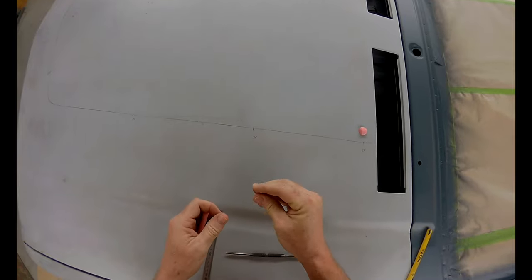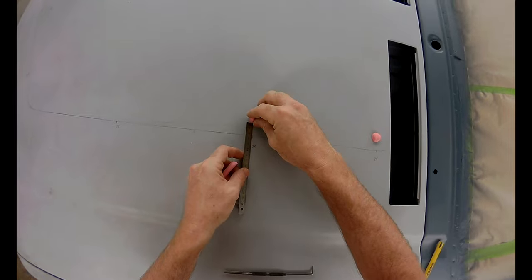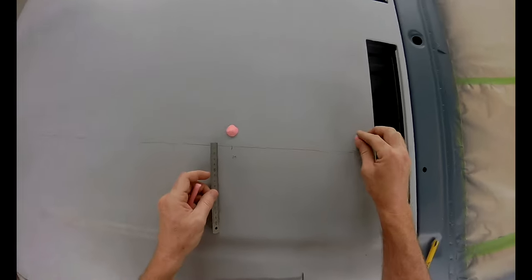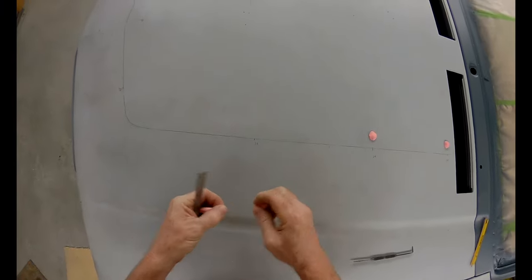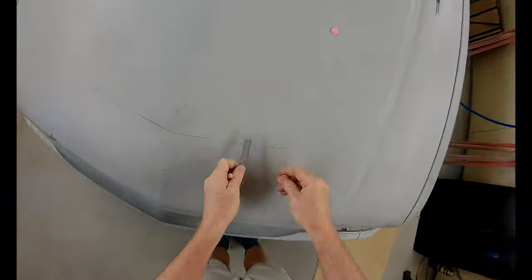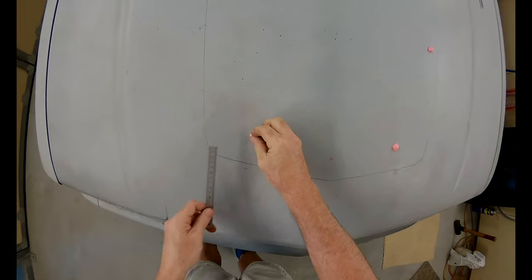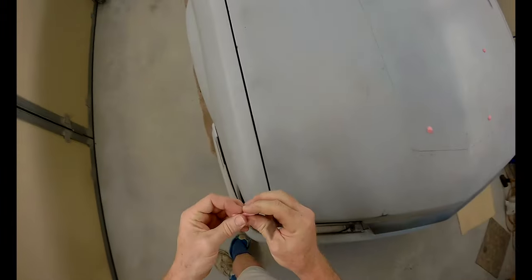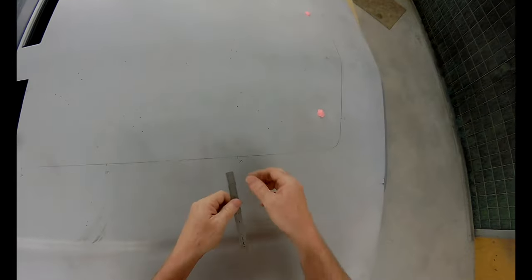We don't need the blob to be that big. Obviously a nice strong bonnet on this one. The bolts going through these are M5s — M5 nutserts — so I'll make the hole 6mm, which gives a little bit of movement room.